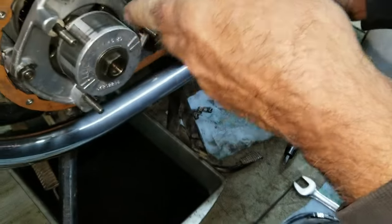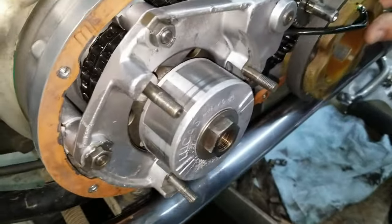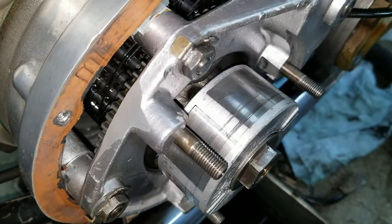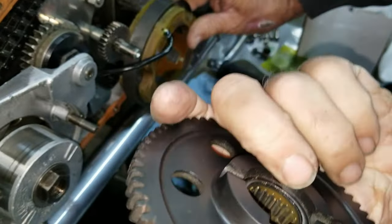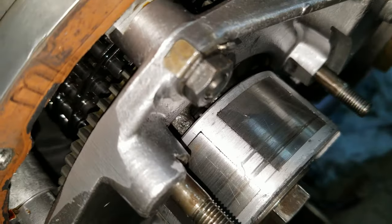And what it's for is as the chain is spinning around, it's throwing oil. Oil runs down that point and it lubricates. It actually drips down inside. Yes, it lubricates. There's these little openings. This bearing that's inside of here and the backside of this. And that's how oil gets in the Sprag.